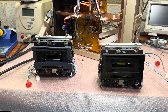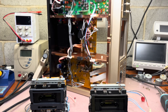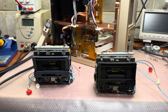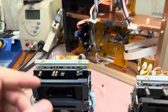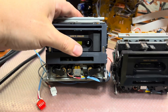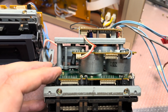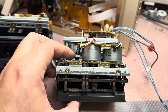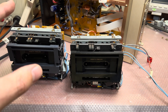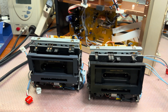Hello everyone, here is part two of looking into speed issues on the Sony TCK7 deck. Finding an answer will help you solve problems with all other Sony decks that have a speed issue. We have a donor tape transport and here is the original — you can see the golden cap. The donor parts are from the 555 series, which has the same nice capstans and nice bearings. Let's start from simple things: replace electronics for the direct drive board and see if it introduces any changes. If not, we will start replacing the capstans and look further.